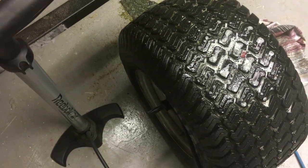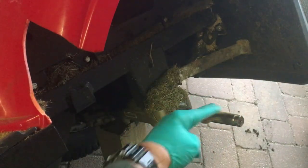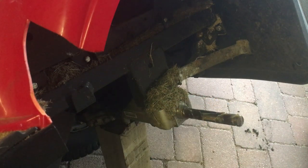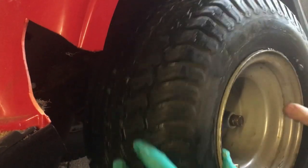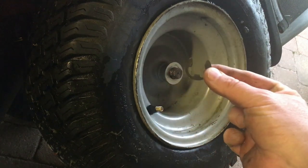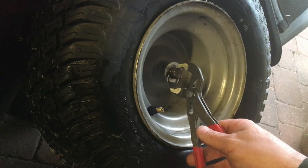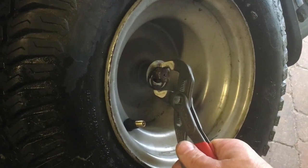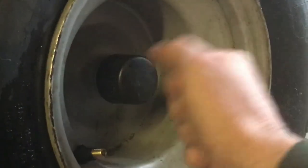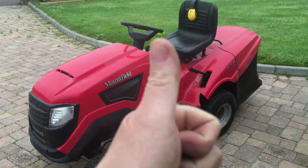Get the tire up to pressure. While the wheel's off, it's a good idea to apply a bit of grease to the axle — it doesn't matter if you don't have any, but I'm doing it since the wheel is off anyway. Simply fit the wheel back on, insert the retaining clip and push it into the groove, then use a pair of water pump pliers to squeeze it on — you'll hear the click. Then put the hub cap back on, and that's it, done.